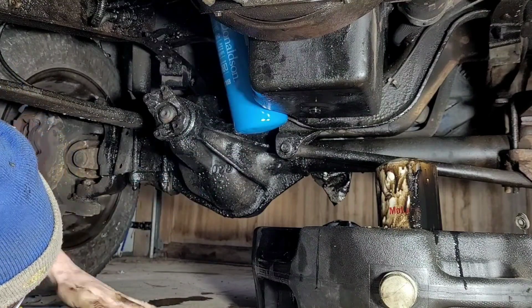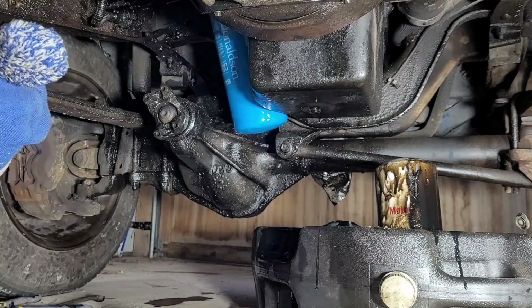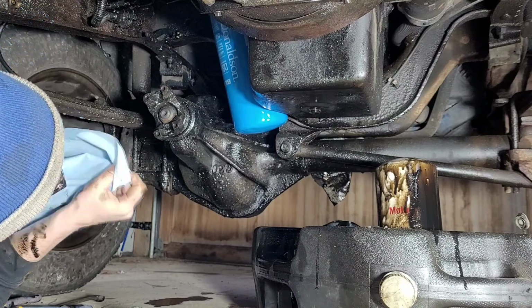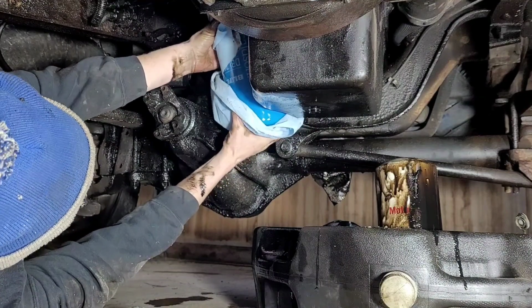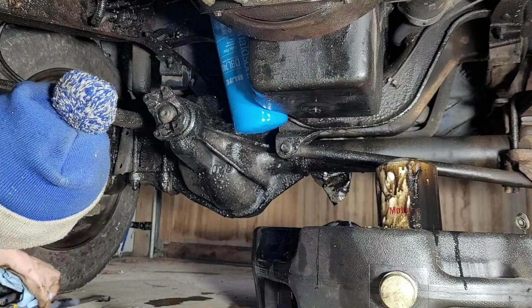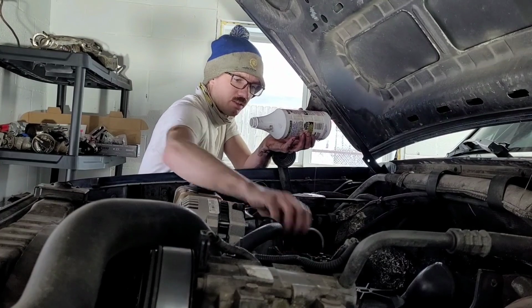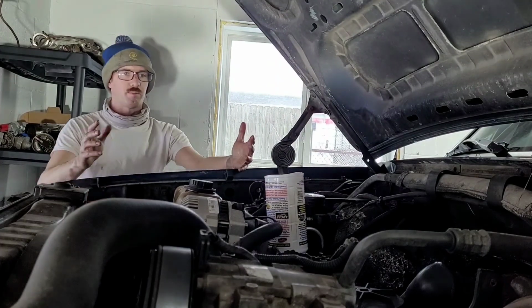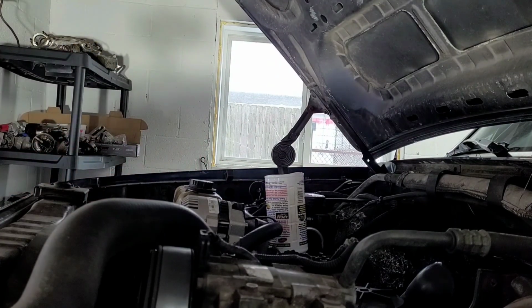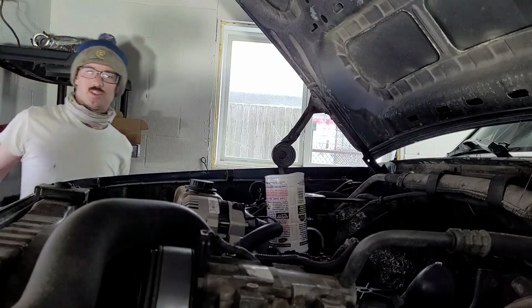As you can see, it barely fits on there. Swimming in oil. But it is worth it. Another nice thing about a 17 quart oil change: you use the one bottle of Lucas, you cut the bottom off, and you have yourself a nice disposable funnel. The math just kind of works out nice, although you don't end up with much for spares for oil.